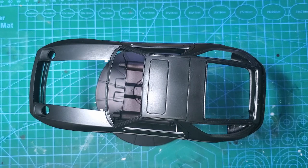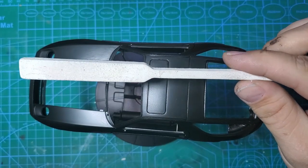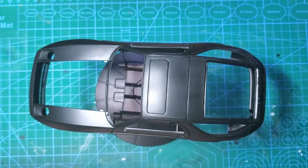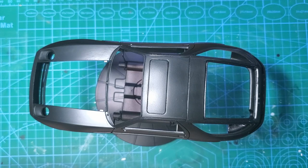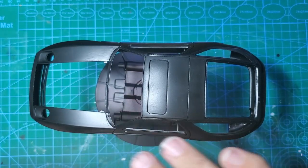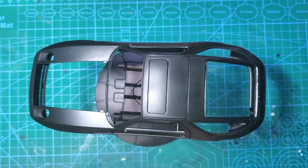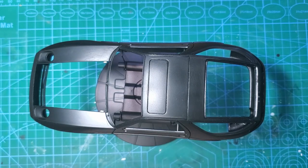One thing that helps, especially if you've sprayed 2K, is to take a sander to the flat spots. I use my 120 grit UMP thinny stick - I lovingly refer to this thing as the chainsaw. You want to go through the flat areas. Don't hit any of these edges, don't hit these curves - anything that's going to reshape the body. That thing will tear into plastic really quick.